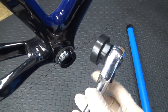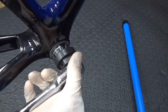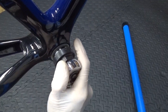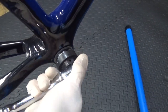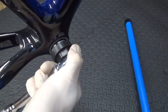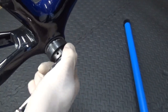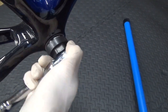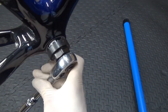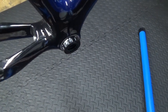This tool takes a half-inch drive ratchet. As I said earlier, it's anti-clockwise for tightening on the drive side. Go ahead and tighten it until it stops — take your time tightening it all the way down. When it can't go any more, just leave it at that and then you can move on to the non-drive side.